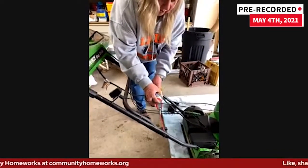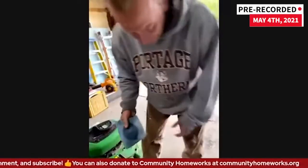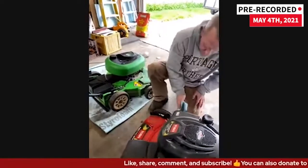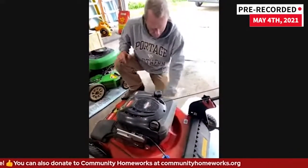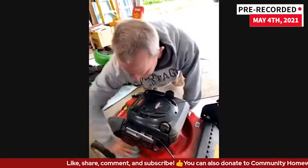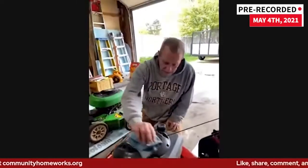When you're done, your rag is going to be all oiled up. What I'll do is use that oil-laden rag — a good old farmer's wax — to clean off the top of this deck, wiping off the excess oil on that. It's going to help keep debris and whatnot from building up. Same as the underside of the deck — you don't want a bunch of crud built up, rotting that deck out. So I clean that stuff off. You can do it with a leaf blower or just brush it off with a broom. That simple oily rag is kind of a nice basic wax to keep water away.